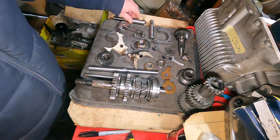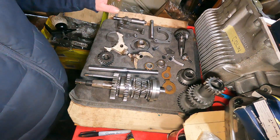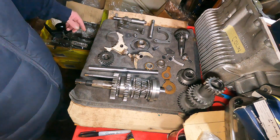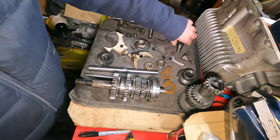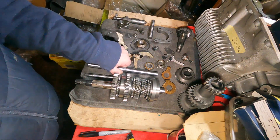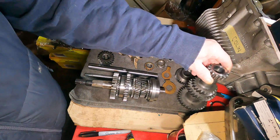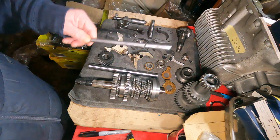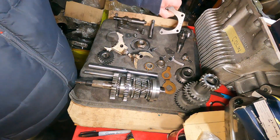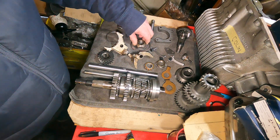So you've got all your shifting stuff here — shifting forks, everything to do with the shifting mechanism. You've got your reverse gear shaft here. Actually I'll put reverse gears as I was down there. Input, bottom drop gear, lay gear, main shaft, new competition, lay shaft. That's the lay gear by the way. Shifting tube and all the associated bits. Your bearing pinion retainer which has all been cleaned. Pinion nut.